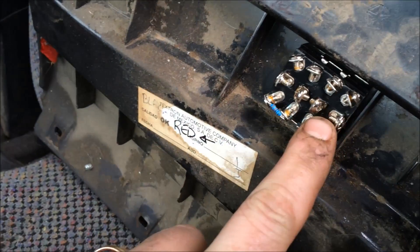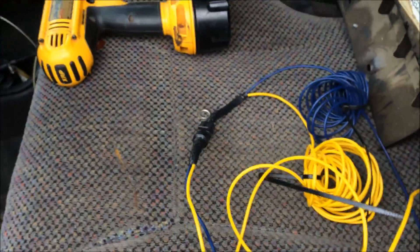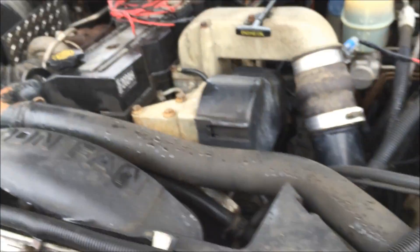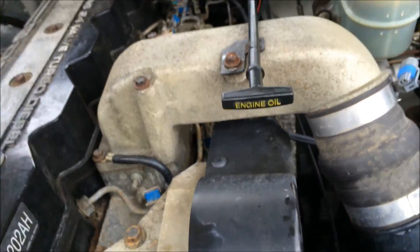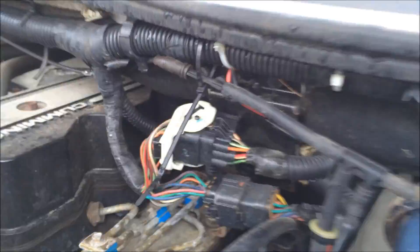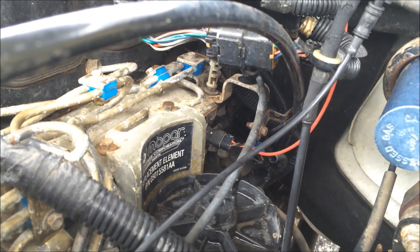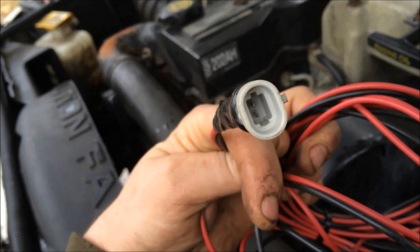This is the coolant side, this is the air side — so it's pretty simple. This wiring harness is for the air intake. The yellow and blue one is the coolant temperature plug, which is right here. So you unplug this and splice in your switch, which takes it up front. The air intake is back there — this is the plug that's in the side of the block. It's a Delphi plug and the other end is right here.